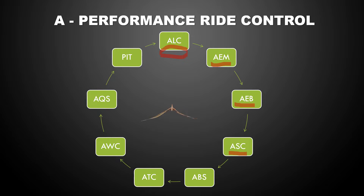The next function you can adjust is the anti-lock braking system. It is a cornering braking system, so it measures your lean angle to keep the wheels from locking up. It has three levels. Depending on how much you want it to intervene, you would select one, two, or three. One will have the least interference, and three would have the most interference.